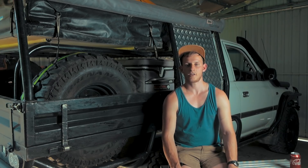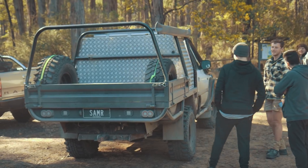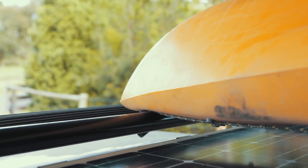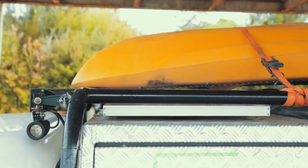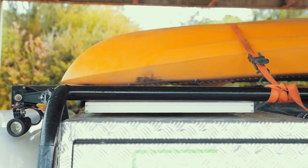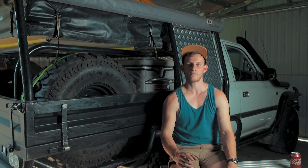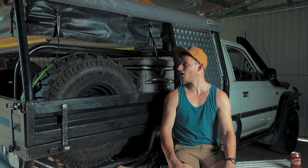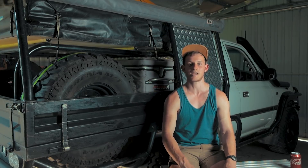At the moment we've got two 33s in there — that's the setup we take on touring — and it still manages to fit my big 36-inch spare in there. I wanted the light bar to sit pretty level with the roof, but also wanted the roll bars to stick a little bit above it so I could run lengths of timber over the top if needed. Every measurement on the canopy had to be checked for the right height — the solar panel height, the air gap underneath it, the fridge height — everything fed into the height dimensions of all the roll bars across the whole tray.